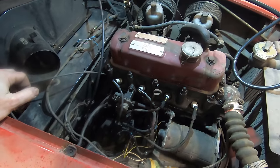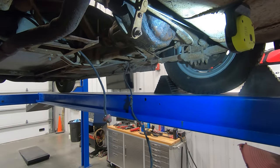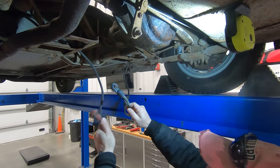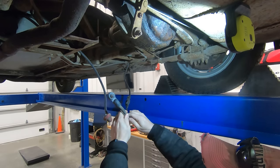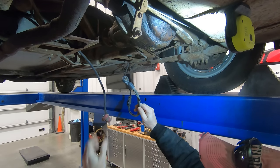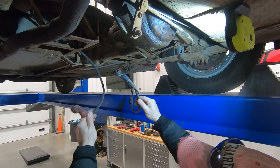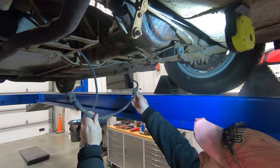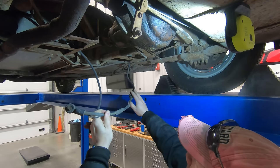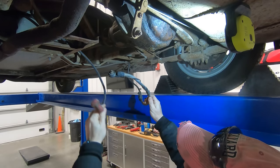Okay, I think we're ready to try to start this. Turn the ignition on. Looks like I need more power than what the battery pack can supply — the engine's cranking over real slow. A lot of that has to do with the bad situation with the battery cables. Someone, when they changed it from two six-volt batteries to one single 12-volt battery, also put side terminals on the battery cables. You can see right here this battery cable is connected to the original top-post terminal, so I'm going to need to take this apart and clean that up and put top posts back on.